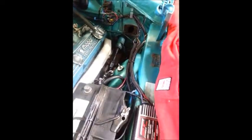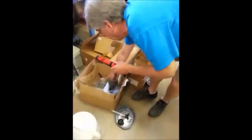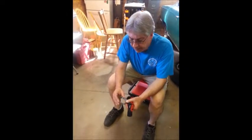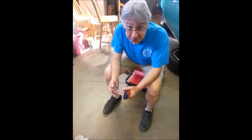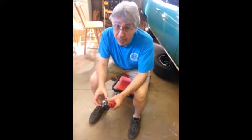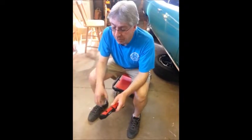A little bit of a slowdown this weekend was the bearing race - the way it seated, the inner wheel bearing, the way it seated into the rotor. After a bunch of back-and-forth cryptic emails with Dr. Differential, who I purchased this kit from, it seems the bevel on the bearing race that came with the rotors wasn't as correct as the ones that came with the Timken bearings. Luckily, my buddy at the local friendly neighborhood brake shop on a Saturday afternoon for a whopping $10 punched out the bearing races and pressed in the correct ones.